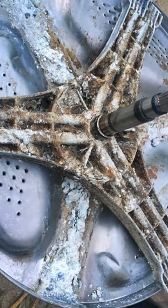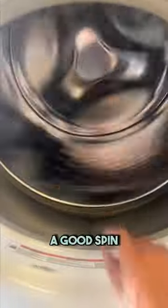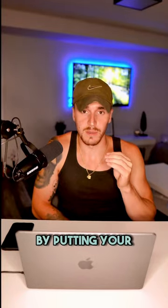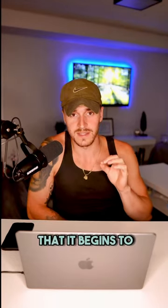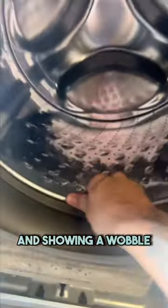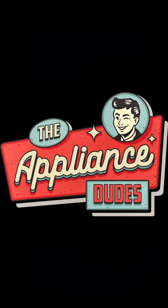Another test you can do is put your hand on the inside of the washing machine and give the drum a good spin. You'll notice there is a wobble in the drum. You can test this by putting your finger over the drum as it turns and you will notice it begins to slightly bounce up and down. If your washing machine is making this noise and showing a wobble in the drum, then it is not worth repairing — just replace the washing machine itself.